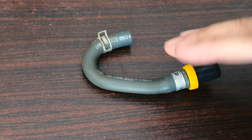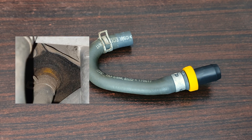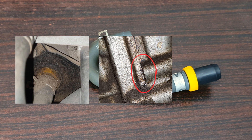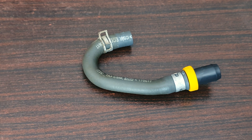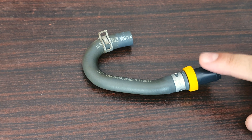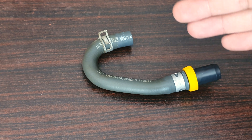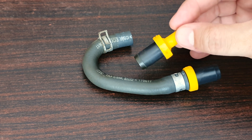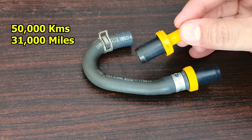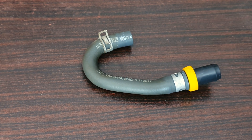If this is blocked, where will the crankcase pressure go? It can go past the seals. It can cause weak rubber seals, gaskets, or liquid gasket seals to rupture. It can also push oil past the piston rings, which can cause oil burning. And if you burn oil, you are going to ruin your catalytic converter. So this is a very important piece. In your owner's manual, it will not be mentioned when to replace this. But in my case, I prefer to replace it earlier. This old PCV valve is only around 15,000 kilometers old. Again, it still probably is functioning, but for peace of mind, I'd rather replace it. Thanks for watching.